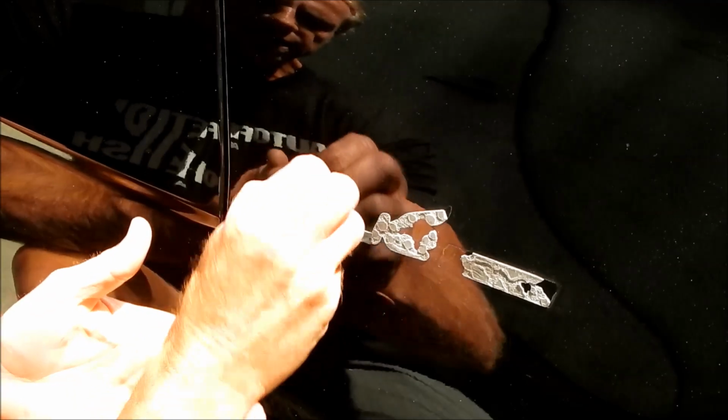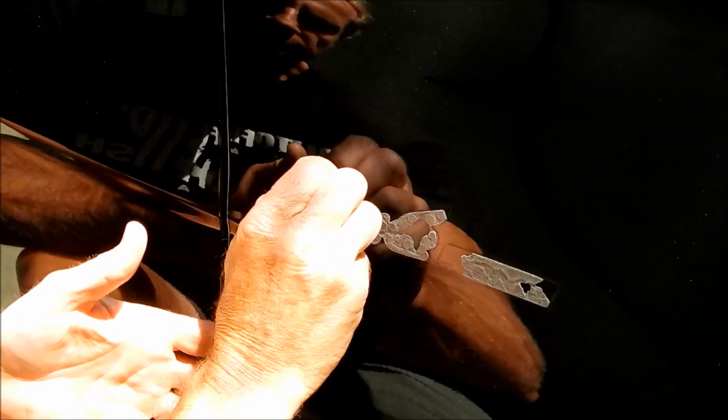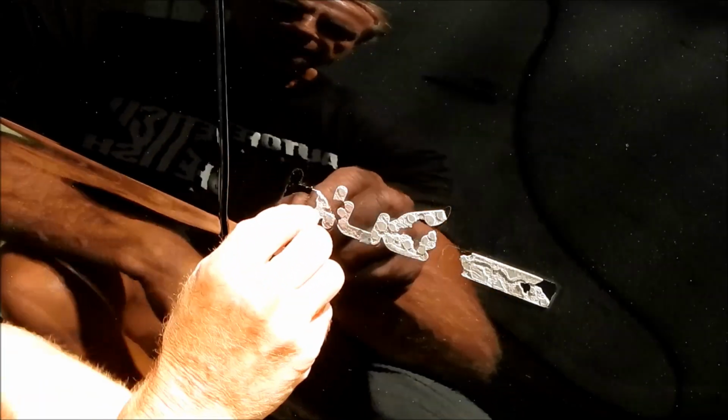Now, at this point, this is actually the most difficult part, in my opinion, is how do you get this double-sided tape off without abrading the paint? Now, you can use traditional adhesive removers, which I would not recommend at this point, because what would happen is, yes, it will break down the double-sided tape, but because there's so much tape, it creates this big gooey mess, and you're constantly wiping, and it just becomes a sticky gooey mess. So at this point, I'm either going to sit here and just peel it off by hand or by finger, and if there's enough of it, you will blister up the tip of your finger, because like I said, this tape is meant to stay there for life.